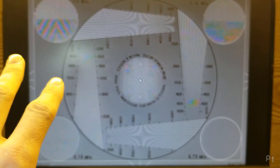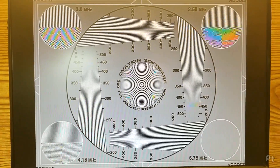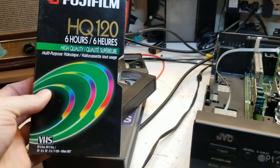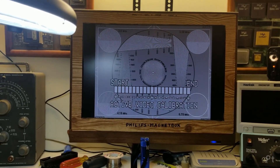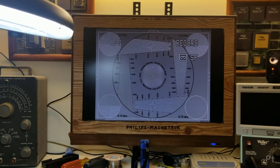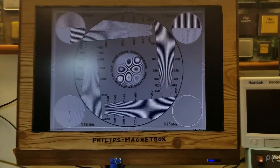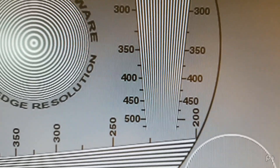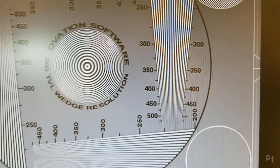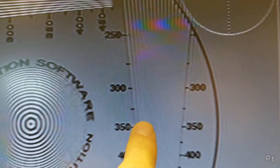The VCR is definitely capable of decent resolution. Let's record this on a regular VHS tape, non-SVHS, on SP, and see what it looks like. It's doing active video calibration — similar to what you'd do on a three-head audio cassette recorder. Okay, coming straight out of the DVD player you start to lose resolution closer to 450. On the regular VHS recording — what a difference — you've got nothing up at 250, just nothing at all.